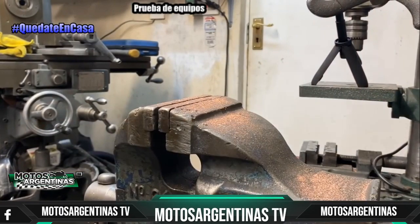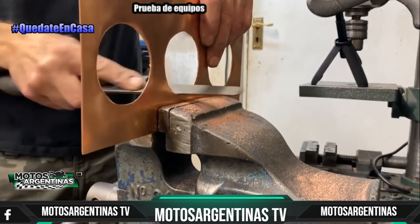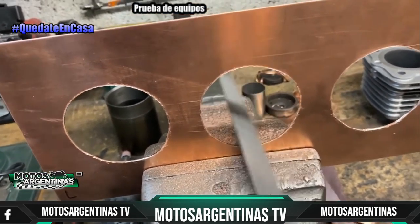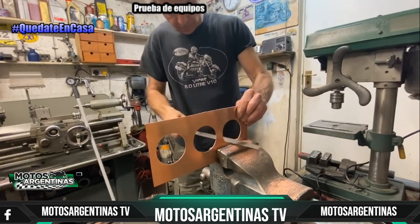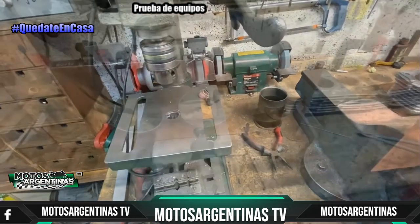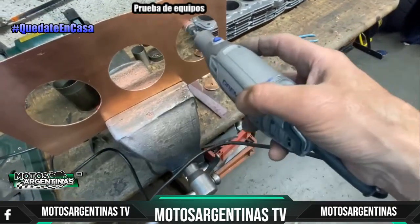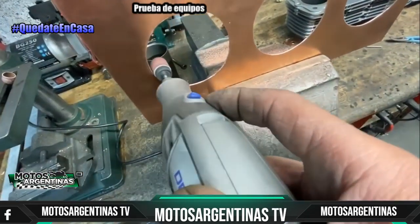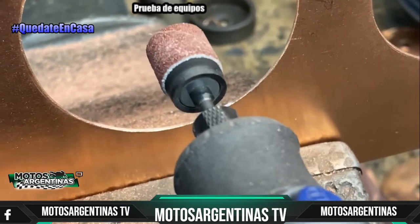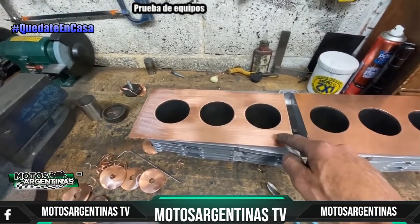So the next thing is to clean them up a little bit with a file, just to take off all the sharp edges from using the tin snips. After I finish filing all 6 bores, I use my Dremel with a sanding disc to smooth down the surface and make it all smooth and shiny. With the polishing complete, I place the 2 copper gaskets back on top of the cylinder block and get ready to mark out the periphery and drill all the holes where the studs are going to go.